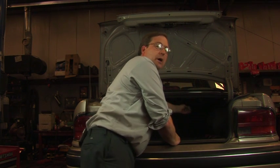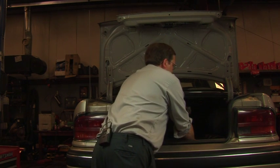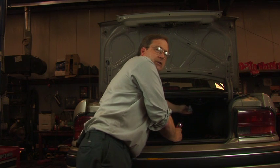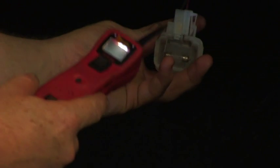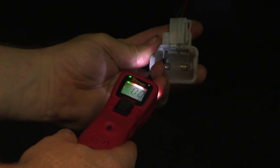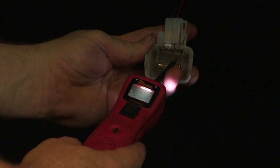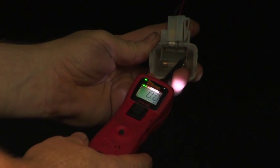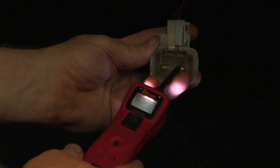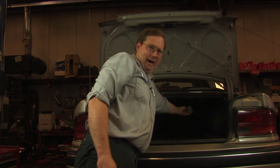We need to determine what it is that's missing. I have a tool hooked up to the battery directly so we can determine if we have power or if we have ground. I hook up the ground connection and the green light and tone indicates that we do have ground on the ground wire. Yet when we go to the positive side, where it should make a different tone and light up red, it still shows ground. That's an indication that we do not have battery positive making it to the load itself.